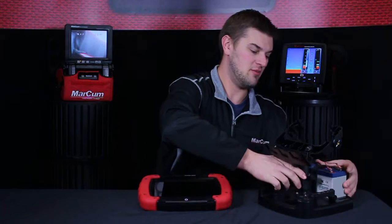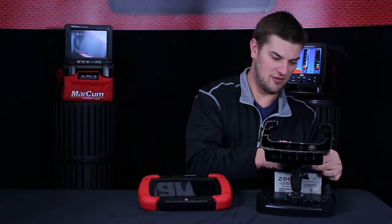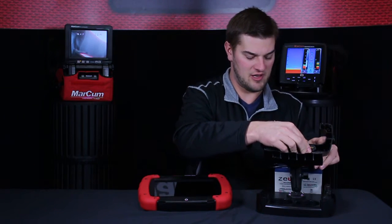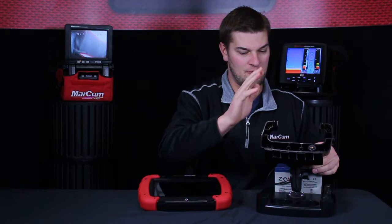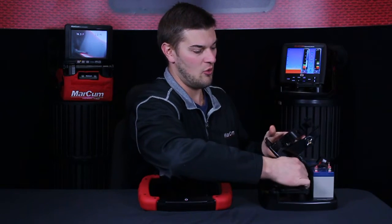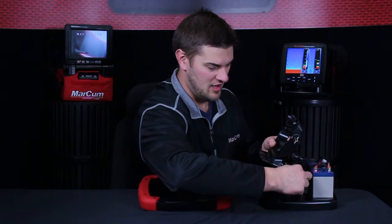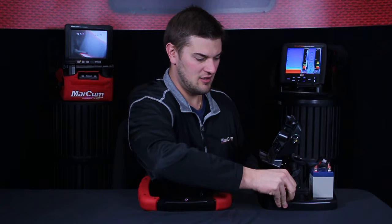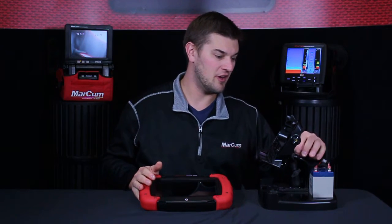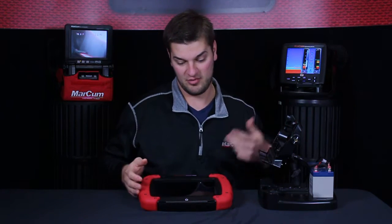I also want to make sure that I don't forget to attach my power cord to the back of the docking cradle. This will ensure that I can run off of the external battery source and charge the internal battery from the external battery when my RT is properly docked in the cradle. If you are ever noticing that your internal battery is not charging, one simple fix could be that this might not be properly attached, or you could have just simply forgot it.